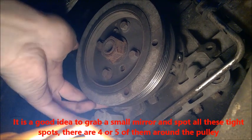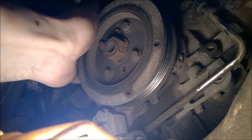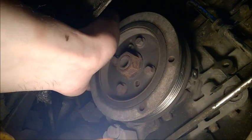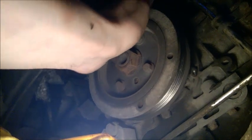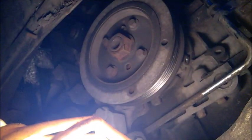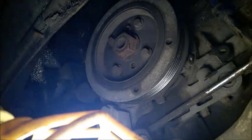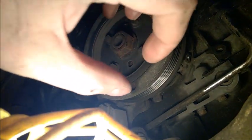There's also a very tight space at the bottom and a cover near the top rear. Both the old and new belt need to pass through all these small tight passages. For the old belt, it's just a matter of fiddling since it's stiff — it's probably easier to just cut it off right away.